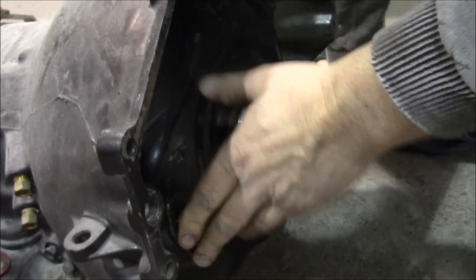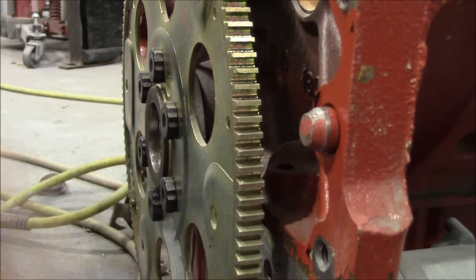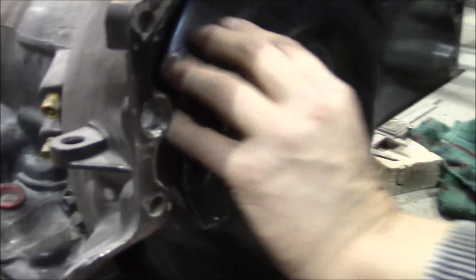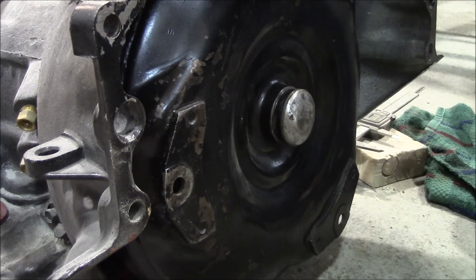You're gonna slide your torque converter up onto your shaft - it's all loose there. Sometimes the first click happens so quick you don't even know there's one. See how I can still get my hand way in there - don't leave your hand in there when you're pushing this in. Give it a little wiggle and a turn. There's two - come on - there's three, there we go, that's in. Now you're gonna take your transmission - these bigger holes are your dowel pins on your motor, so you line your tranny up and the dowel pins go in there to hold it in place.